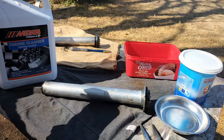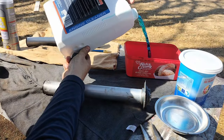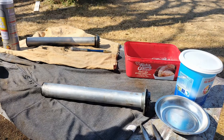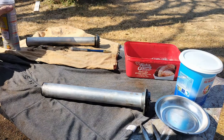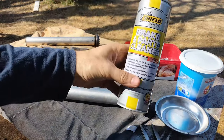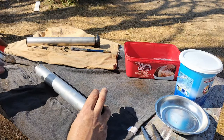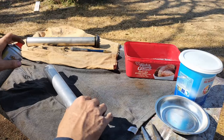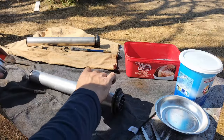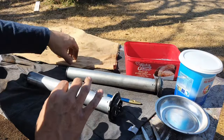These fuel sender units at the bottom have a little screw to keep the bottom on, and keep in mind, you'll see it in a moment, there is a very thin wire inside. In the 240D's, that one was broken off and I had to repair and resolder that, but that's just to clean it out to give it a more accurate reading, so it doesn't jump so much. And I used brake cleaner as well over here. Probably should have worn some gloves as well, but you know, this is Africa, so we tend to ignore stuff like that.